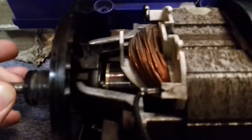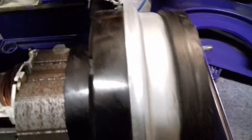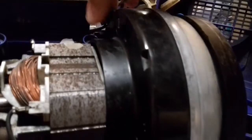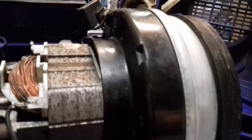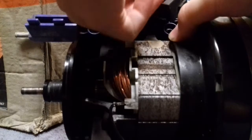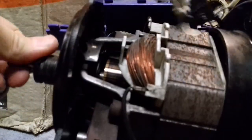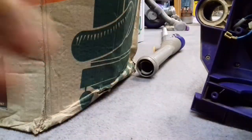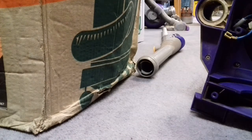Now I'm going to pull this apart. We can take the seal out because this seal up here only comes out once you've got the two parts separated, otherwise you tear it. Here's the motor - in very good condition actually, that's quite clean. I'm just going to disconnect the spade connectors. This is actually a bit similar to the motors in the new Henry - these brush holders, the carbon brushes. Now we'll take the seal and try to pull this motor out. I have great difficulty putting these motors back in - I never seem to get them in properly. But there it is, big beast of a motor. Let's take the axle out if I can get it out - it's a bit wedged in there. I'll remove that later. We'll put the motor to one side. We're nearly there - it doesn't take long when you're not stripping apart the cyclone.